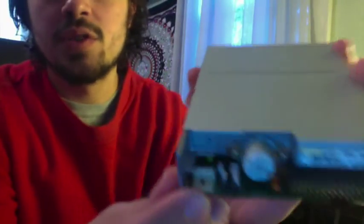So then we're going to need a power cable for your card reader. My Molex connection from my motherboard to my card reader — my floppy disk drive had this 4-pin mini-Molex. So does my card reader, so I didn't have to do anything except unplug the floppy. If you're going from a zip drive, you might need to make some modifications — I'll link that below.